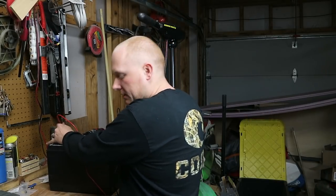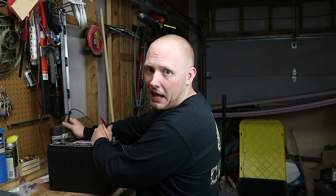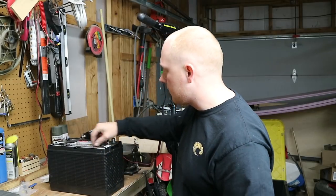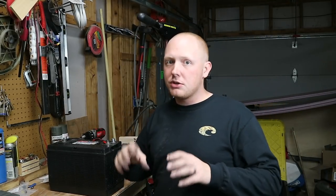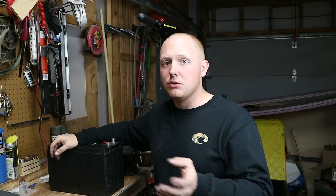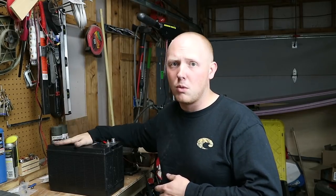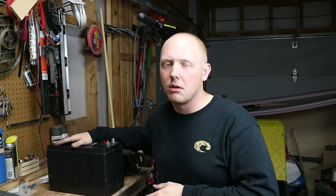Easy test: we've got our battery and we test it. A battery that's fully charged at a resting phase should be at about 12.5 volts. That battery should be able to power your trolling motor when it's sitting at a resting position of about 11.3 volts or somewhere in there. Once you get much lower than that, you're not going to have a whole lot of juice left. The other problem could be that one of your cells are dry. These ones actually have a maintenance cap on them — you can crack these open with a flathead screwdriver, and you'll check the water level. There are lead plates in there, and the water should be just above those plates. If you end up draining one and it's not holding any charge anymore, these batteries have a one or two year warranty. You can go back to Walmart, tell them your battery's not working, they'll do a battery test on it, see that it's got a dead cell, and they'll just swap it out for you.